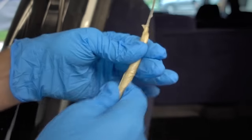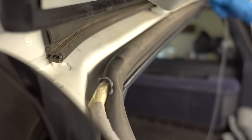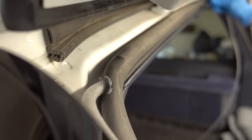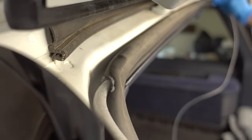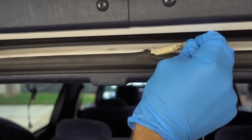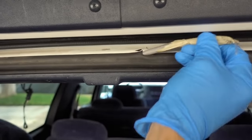If I tried to run all the way around the corner, I found that the tension would become too great and the foam would just tear. So about center to corner was perfect. Also, I used a heck of a lot of lube. I have this super lube grease that worked perfectly, and I'll put a link down in the description below. One thing to note: on the two sides, there's actually already a rubber insert about midway, so you've got to use that as your stopping point. Another note is the size of this piping can actually fit right through those tiny holes in the back, so there's no need for any cutting or anything like that.